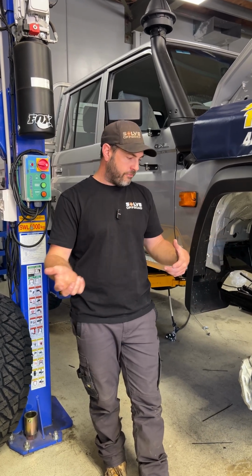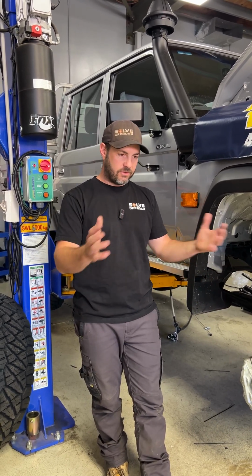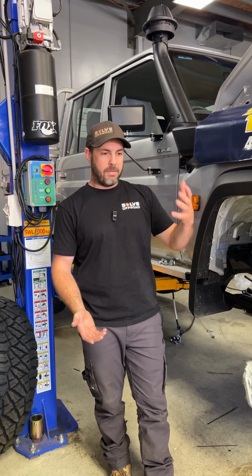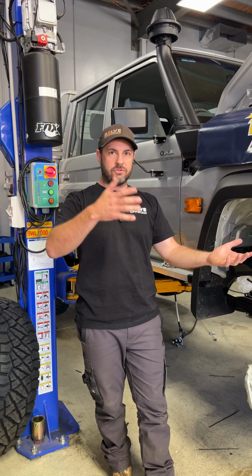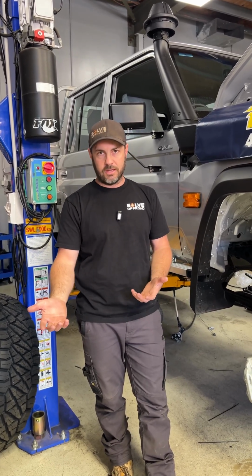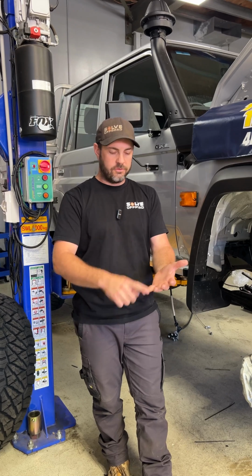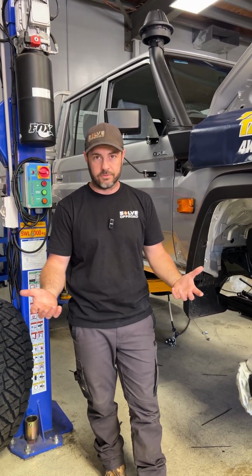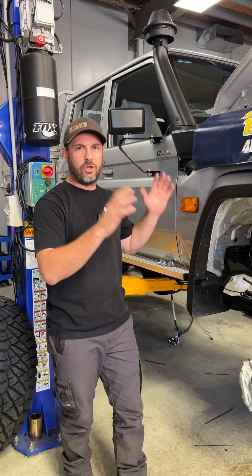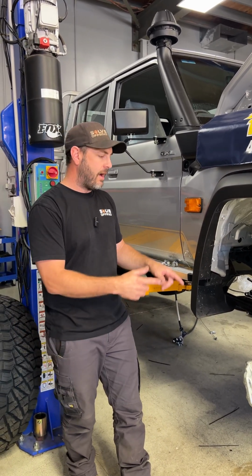Managing your vehicle off-road, change of conditions, sandy, muddy. You're going to be able to play with the pressures to not only manage ride quality, but also manage tyre strength, as in increasing it when you need it, decreasing it when you need it for getting your car through soft muddy ground, but then increasing that tyre pressure in the rocky areas where you want to protect your sidewalls. So it's going to make the car, the touring factor as well, that's a huge thing. That is absolutely massive. We can't wait to see that.